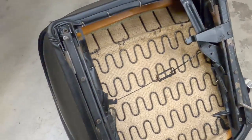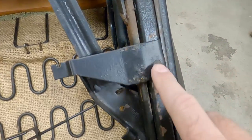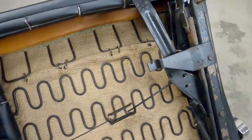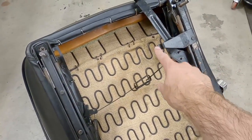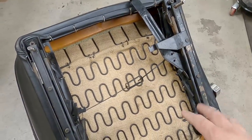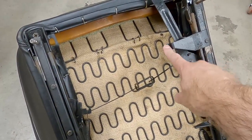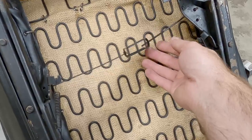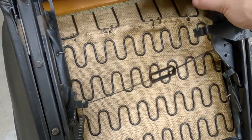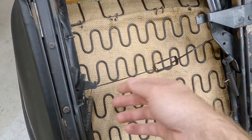Here's a chance to see what we've got to work with. On mine this is actually not as rusted as I was expecting — I figured it would be a lot worse. Your seats may be better or worse, but I did notice that the spring that goes from here down to the back of the seat frame is missing, and that explains the difficulty you have when adjusting your seat. If you feel like you're doing all the work, that's probably because this spring is missing. Also notice this isn't doing us any favors when it's loose like that, because as you manipulate this lever to move the seat track, it's supposed to pull over and allow the other side to come loose, but when it's loose it won't do that.